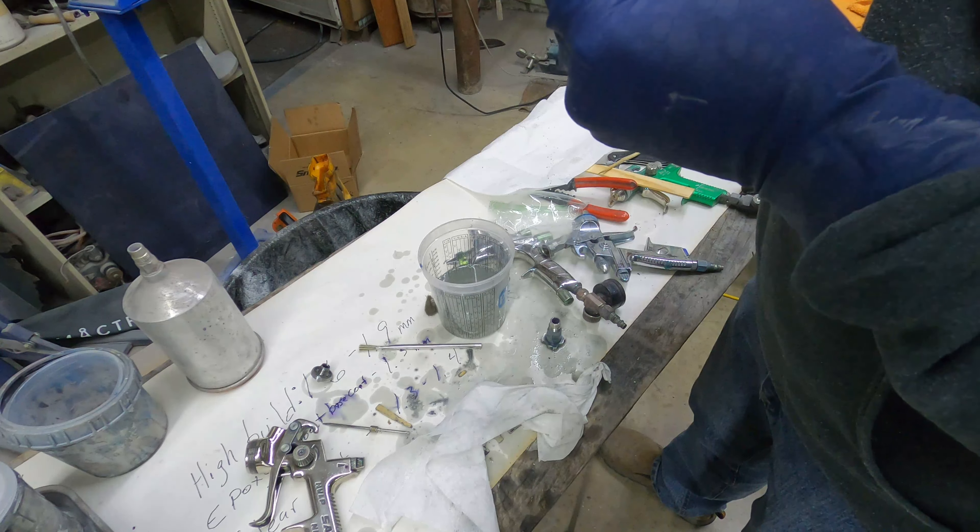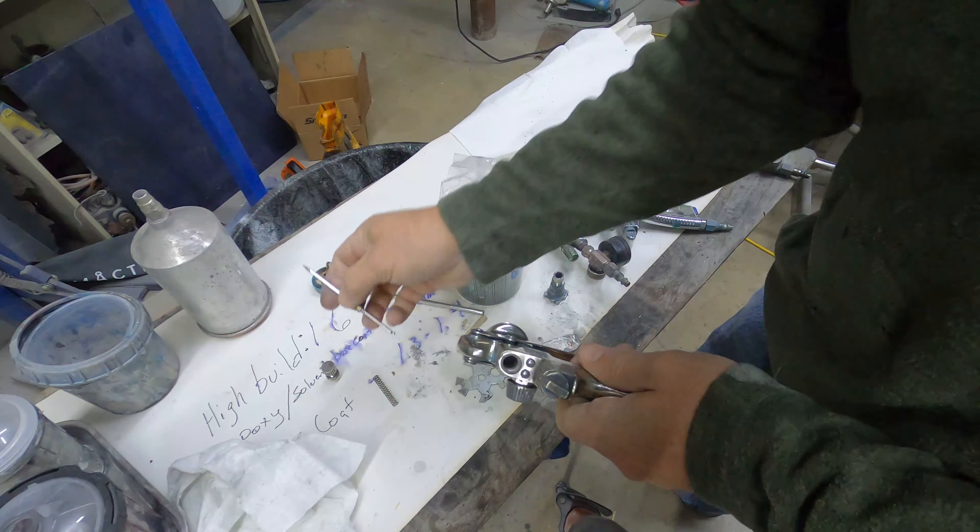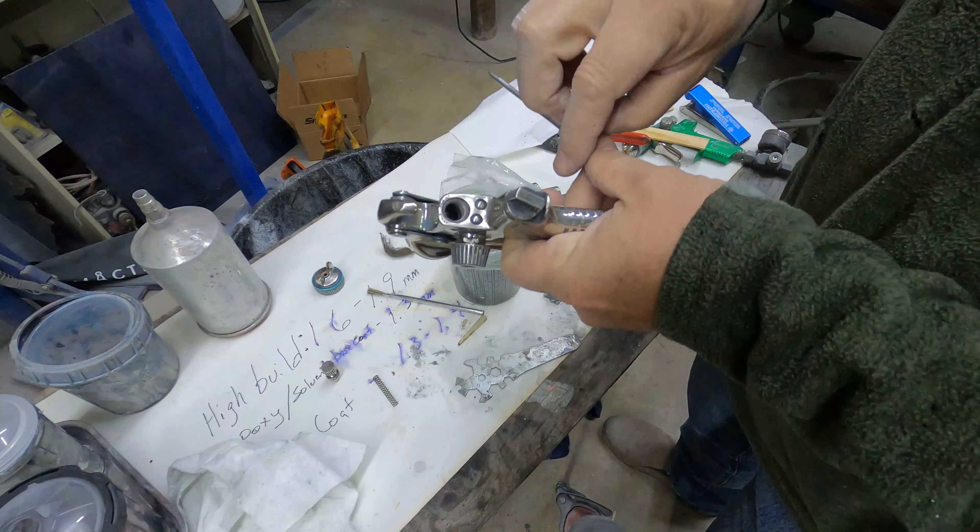You guys have endured long enough. I've let this stuff all dry out — you can see there's still some discoloration because it's a paint gun that we use. Reassembly is in the opposite order. If you have some spray gun oil, it's a good idea to put just a drop or half a drop on the threads on these things because they get really tight putting them back together dry. Snug this down with the paint gun wrench. Any air leaks cause issues.